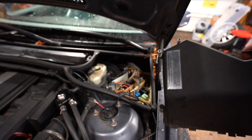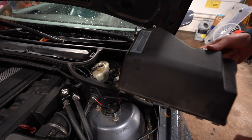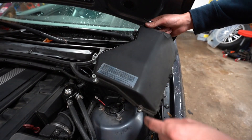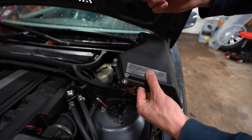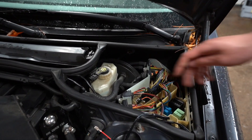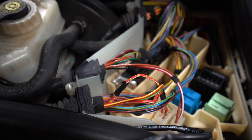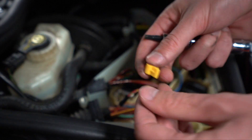Next, you want to route this cable to the DME box with the other angel eye cable. Remove the plastic cover right here — there are four allen keys which are number five allen key to take it off. Just undo all of them, pull up on it, then look for the cable — there's only one cable like that, which is red with a white stripe and yellow dots on it.